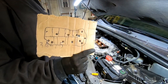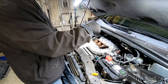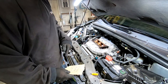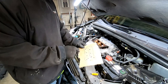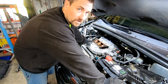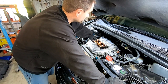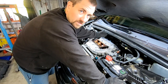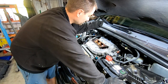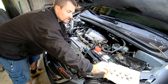I've made a crude drawing of my upper intake on cardboard. I'll take one bolt out at a time and place it in the corresponding hole so everything lines up when I reinstall. There are a couple of nuts in there, not bolts, just to be aware. The intake is aluminum and you do not want to bend it, so break all the bolts loose first to relieve pressure on the gasket and intake itself. I like to start from the outside and work my way in when loosening. The intake did come out and all bolts are right where they came from.